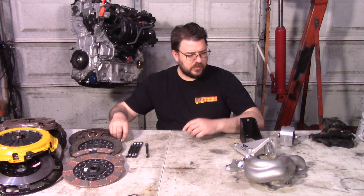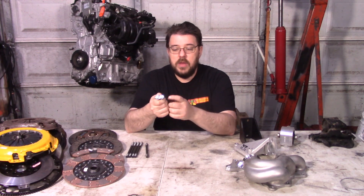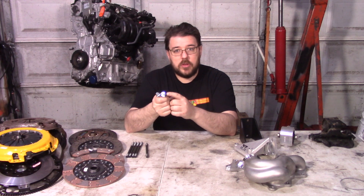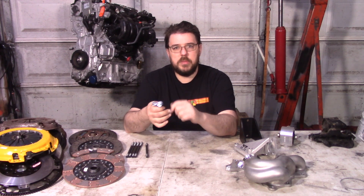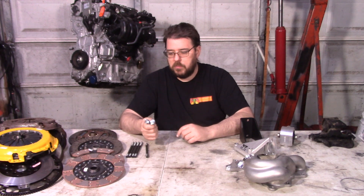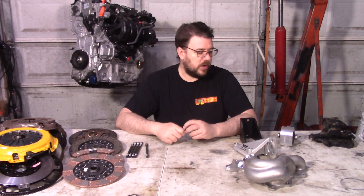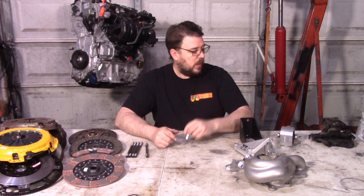And finally, all of this stuff — I didn't put any fasteners with it, but as with all of my other things, I make sure that all fasteners included are JIS flange, so it matches what's in the car right now. It'll have the right size head — you know how when you work on an MR2 you're working with 8mm, 10mm, 12mm, and 14mm fasteners? Well, these are going to match. We're not going to have any stupid 13mm, 11mm, or 15mm. That's so frustrating when you run across a car and have to reach for a different tool because someone was too lazy to get the right hardware. So that's it. Right here you can see the link to the clutch stuff I'm going to be talking about in the other video — see you there.